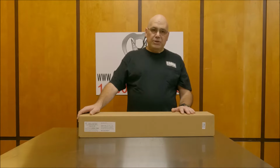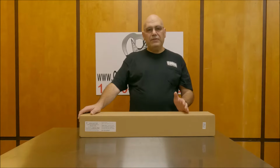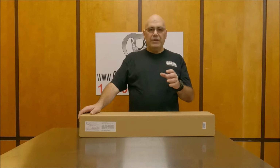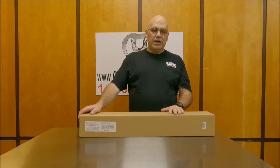If you're not sure which one you have, for 2002 and 2003, it could be an NV125, an LWX 500, or an ATC 500. There's going to be a round tag with some engravings on the back side of the rear transfer case, on the side that faces the rear wheels. That will give you more information on which one you have.